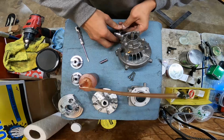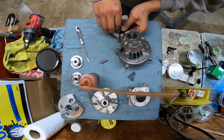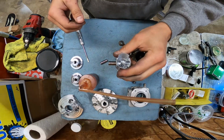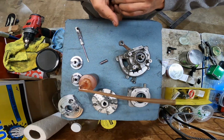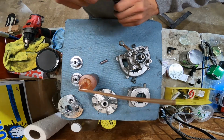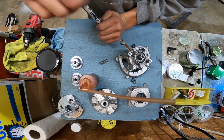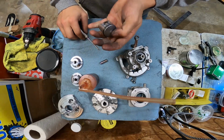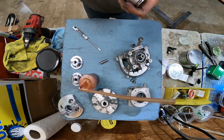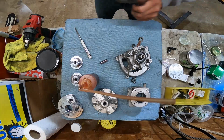I don't remember these being this hard to push through the piston. But it has been a while since I built a GoPed motor. Did I even put that in there straight? Are they really that tight now? Holy moly, they're that tight. Jiminy crickets. Don't try to beat yours out with a screwdriver like I am. Oh man, that is crazy how much tighter they are these days. It's almost like they machined the piston smaller.